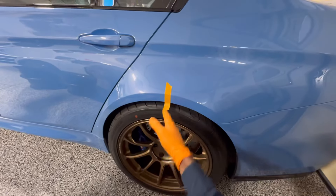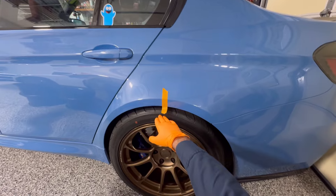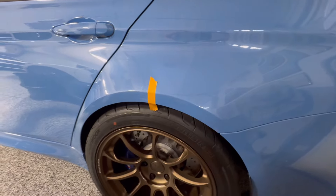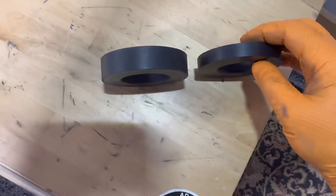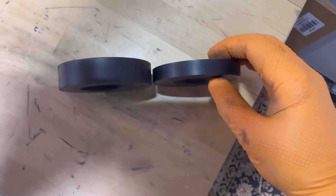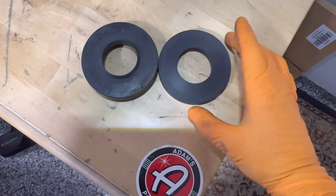We're going to install them and see how the car sits after. Currently I measured it sitting at around 25.5 to 25.65 inches, with a little more than a finger gap right now. Here's one of the old pucks — three-quarters of an inch — and here's the new puck, half inch. You can clearly see the difference. This should do just the job of lowering the car just enough, and they're pretty much identical in design.